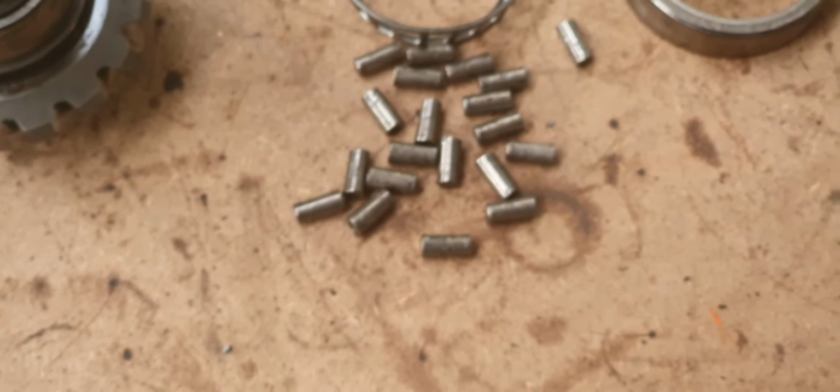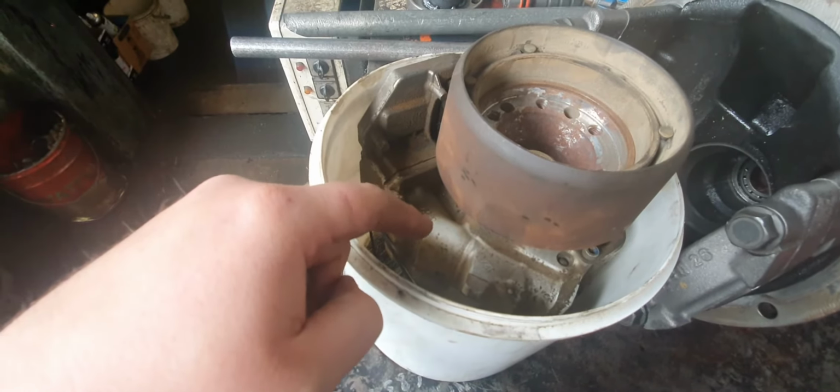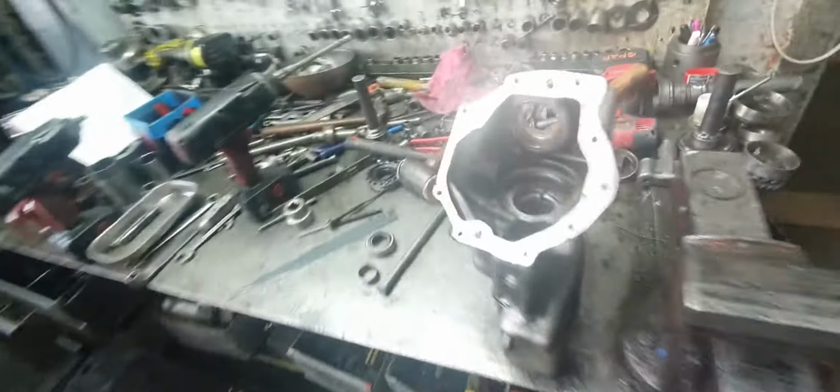This is the housing. They have this unit on the back of the housing called Active on Command, AOC. And it's got all these clutches in there, full of, it's like hydraulic oil or something. And as soon as the front diff loses traction, the back diff, this activates, which activates the back diff. This is the housing, that's where the pinion goes. That's where the carrier bearing is. The carrier goes across here with the crown wheel. Where is it? Where's the carrier? So I can show you.